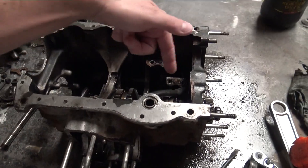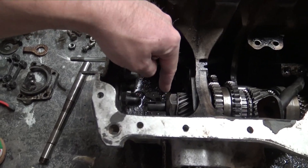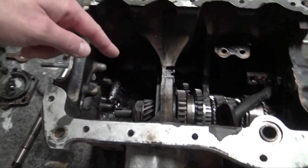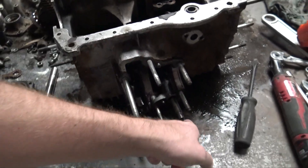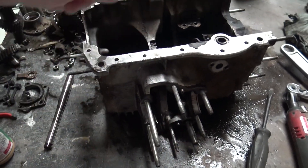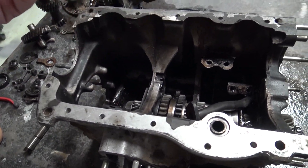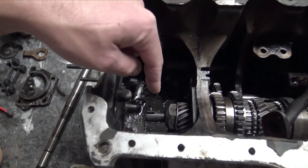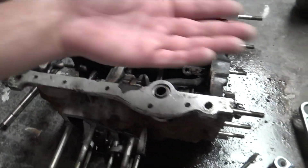The one issue I had with the oil pan is that the transmission is actually inside of it. I need to get this nut off right here, so I need to order a deep socket — I think it's a 36mm, I'll have to check. I already got the secondary shaft out. It would really be easy to pull that nut if I could get this selector stuff out, but you have to have all of these gears out to get underneath that stuff. I'll have to get that larger deep socket and then I can use my impact on it to undo that and pull all those gears out.